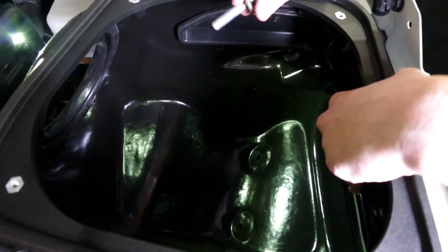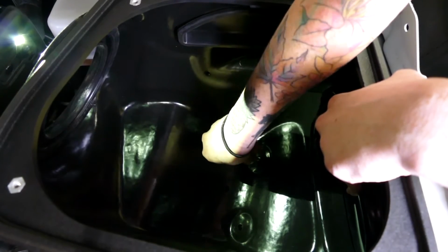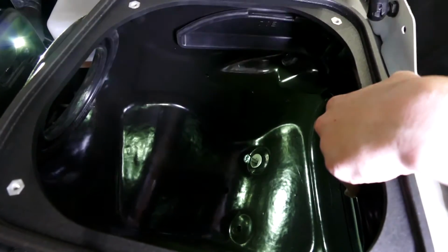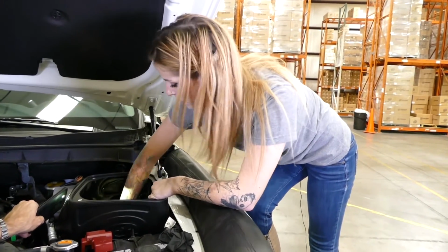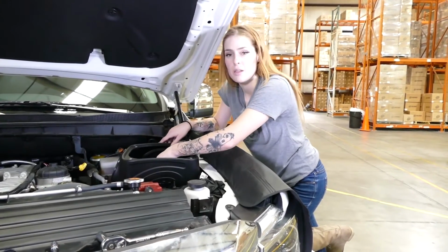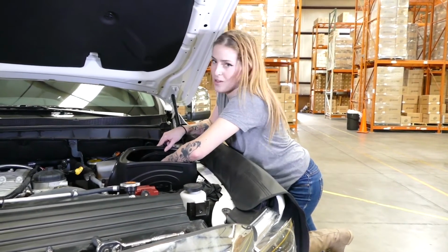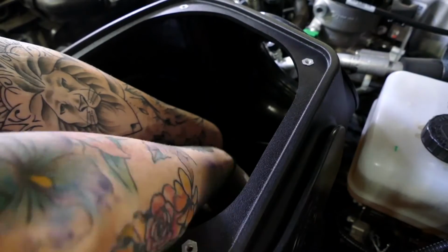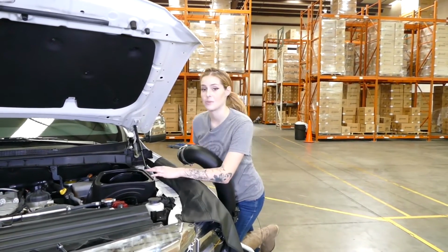So tip number 3, make sure you're lined up with the threaded hole and install the bolt and washer. So you're going to repeat the process for the second hole and install the bolt and washer. Make sure you didn't tighten the bolts at the bottom, so when installing the third and final bolt, you have a little wiggle room. Lining up those bolts sure did suck, but it does look sweet in the vehicle.